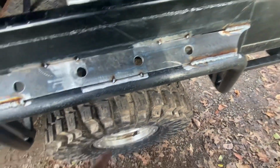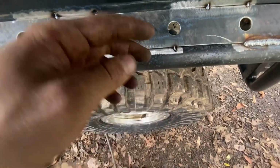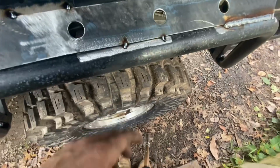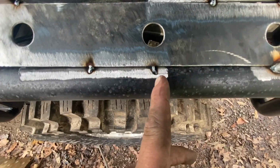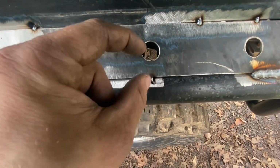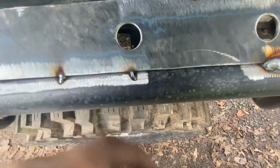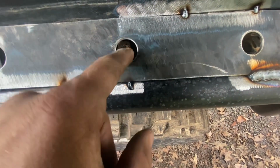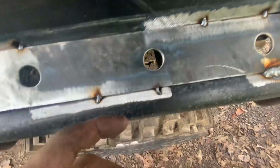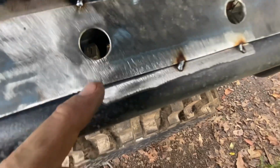Now just another little tip of mine, you can see that's the welding patch I'm going to be doing. Because I've got a poor welding mask, I've just got a little tack here in line with where I want to finish, because I know my mask's so bad I can't really see anything other than kind of what I'm doing, so I can't see really where the hole is. Like I can kind of see, but it takes a bit to look at it.